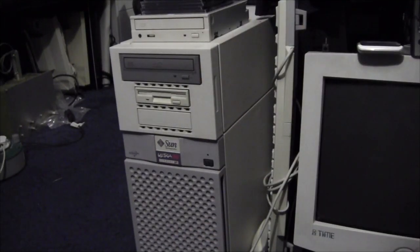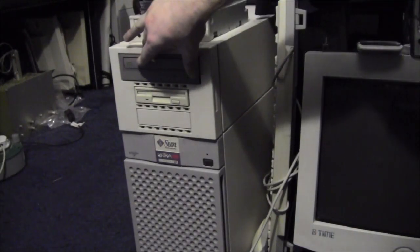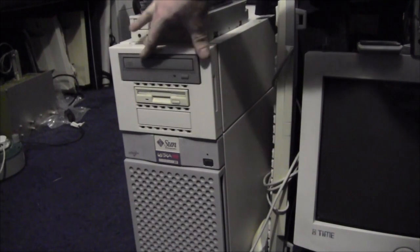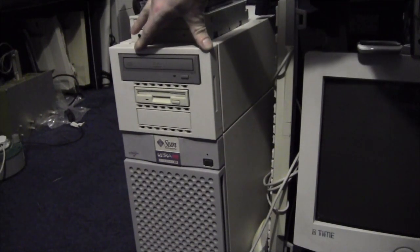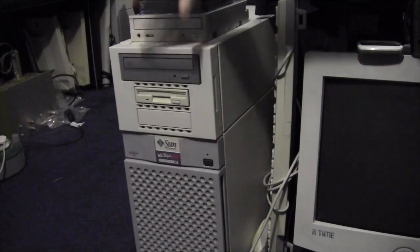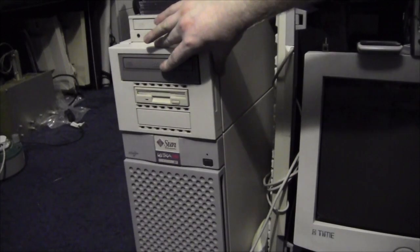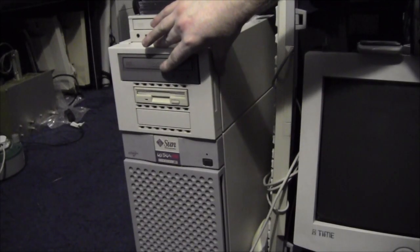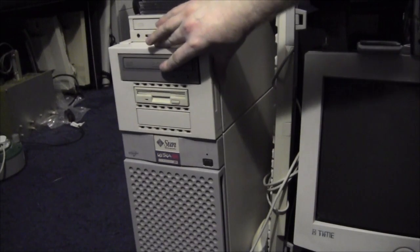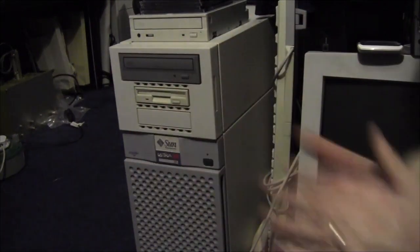So first we thought it might be the CD player playing up, so we swapped it for the DVD drive from the Sunblade that I was giving Rob. This wouldn't, for some reason, boot off the DVDs. We think this is a problem with the DVD player itself. It can't read DVDs, but it will read CDs. We did install off the CD, got to the end of one and came up with the same problem. It didn't ask for CD2, and when we did reboot it, it went to boot device error, trap E3.